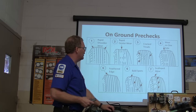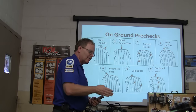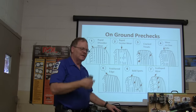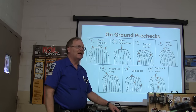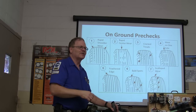You've also got cracked treads. The reason tires come apart when they've been cracking like that is water gets in between the tread and the steel belts, and they slowly lose their bond. Over time, centrifugal force causes them to separate and the thing tears apart.